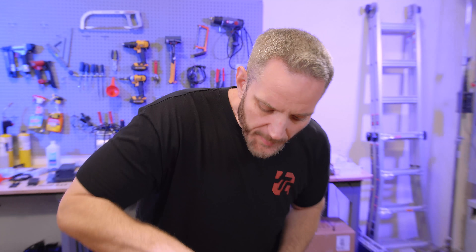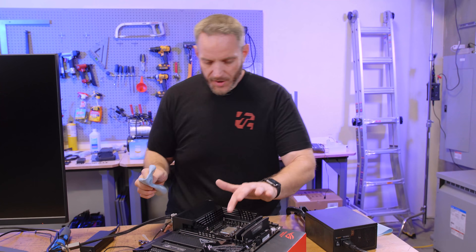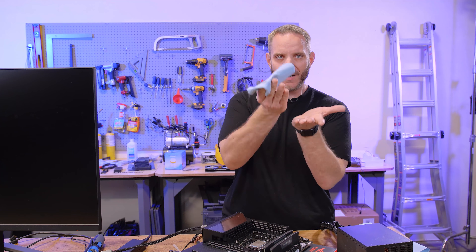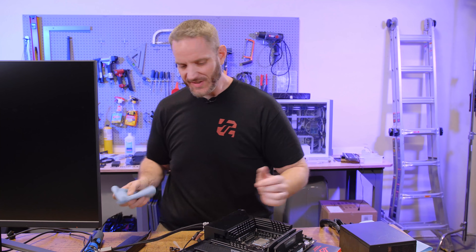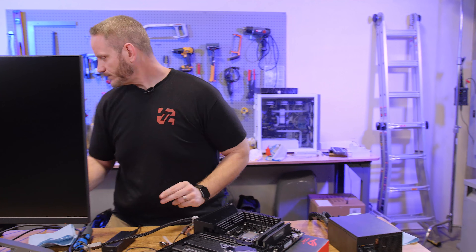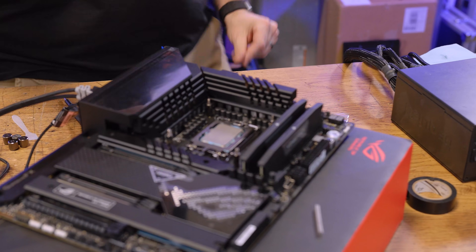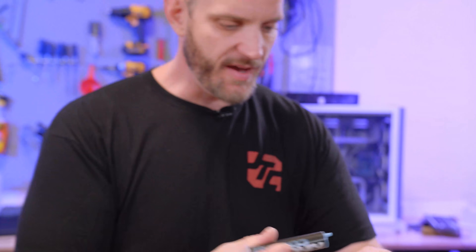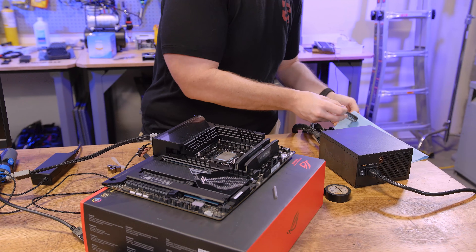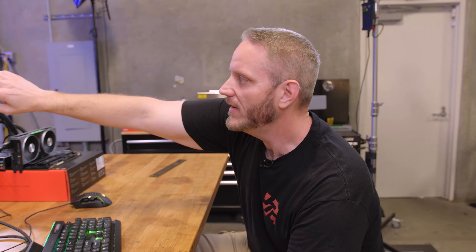They say one millimeter is ideal. If you go higher than that, the issue is the retention can't go higher than the CPU or you'll be touching the retention and not the CPU itself. I'm going to put the same amount of Kingpin paste on there. Who knows — maybe this is why we were cooling so well, because I was using KPX, which I use on everything now. Let's start the test and see what the initial spike is.